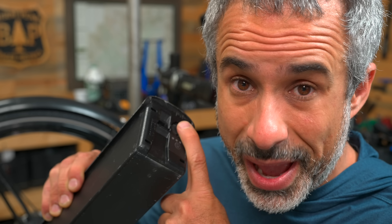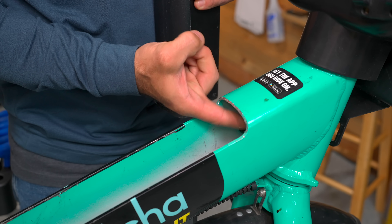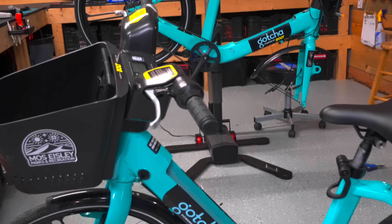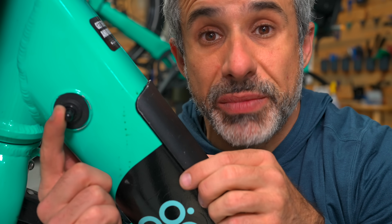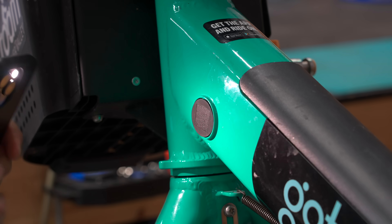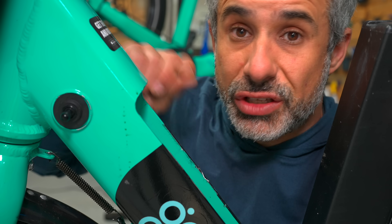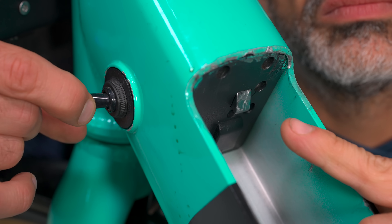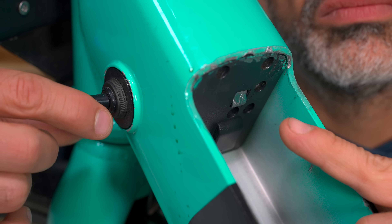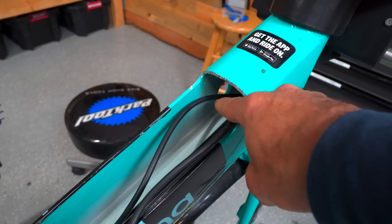You might notice we're missing some pretty important things, like the latch that holds the battery into the bike. Let me take you over to this bike's twin and show you how it's supposed to work. On that bike, the battery latch is intact — if you flip this switch, it comes out. This was quite sophisticated. Originally, this bike had some kind of key card scanner; you'd swipe your transponder and the battery would pop out for service. We had to hack it and hook up a polarity-reversing switch to move the actuator in or out. We can't hack the other bike because there's nothing there to hack.